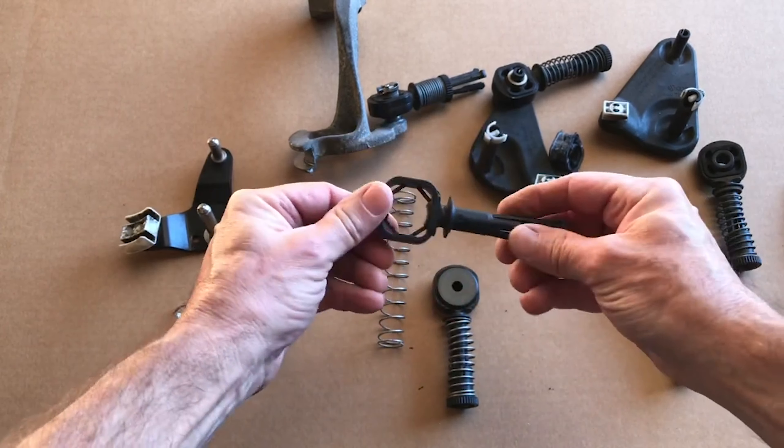Get the lock nut good and tight, but don't go nuts — we've had some customers break that stud, which is really inconvenient. From there, take the bell crank, slide one of the pivot bushings onto the pin, take the slider and put it on the slider pin. Because of the clearance, you have to roll this back and come in at an angle, and once you've made that corner, take the other bushing and slide it into the tube.